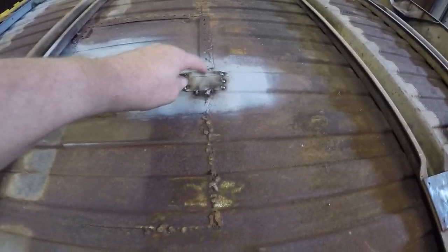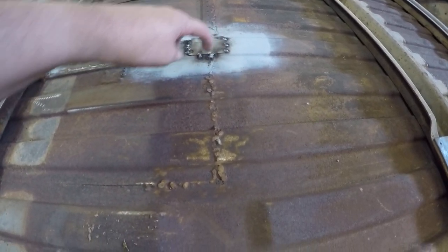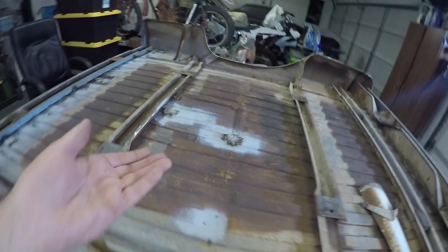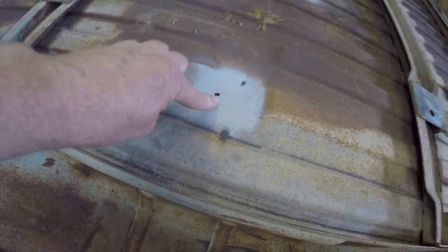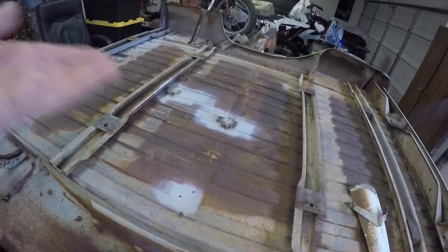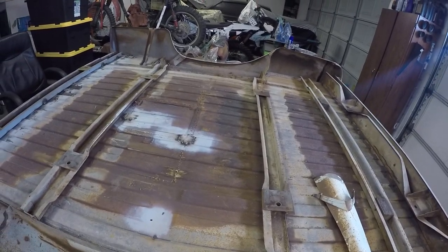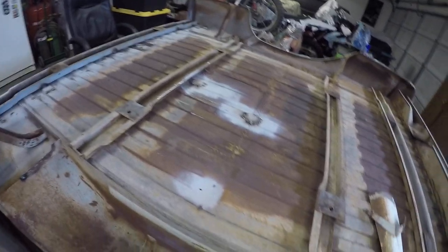You can see where somebody had a gooseneck ball hole cut through the bottom — I filled that all in. Because there's such a big hole behind it, I welded backing plates on. Then I'll weld from the underside — which is the top side now. I need to put another one right here, as you can see. That's welded through primer, and then weld that to it. You'll never see all this underneath here.